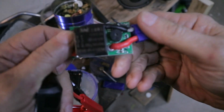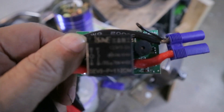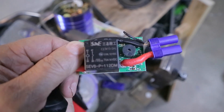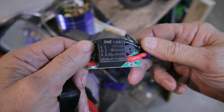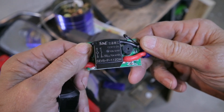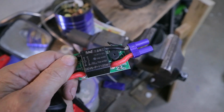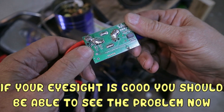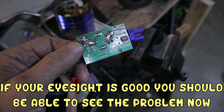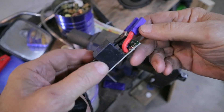Let's see if we can get some more information off of this. This is a 70 amp, 14 volt relay. The relay sounds like it's working - it's making all the correct noises - but I'm not getting voltage out where I need it to go. So I'm going to do some testing and come back and tell you what I think I found. Worse comes to worst, we just remove this from the loop and rely on our own brain not to get us into trouble.